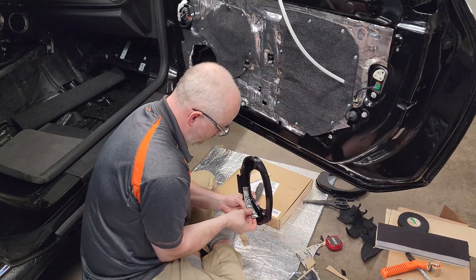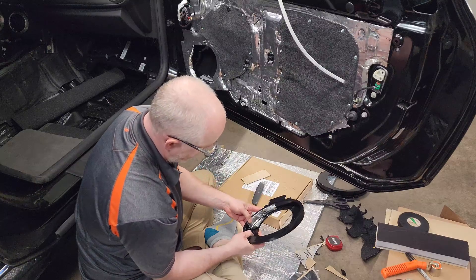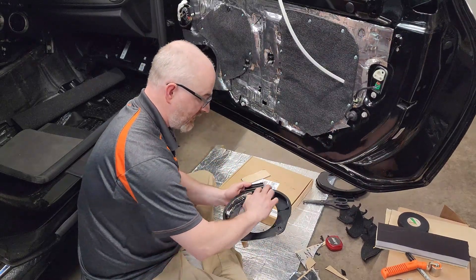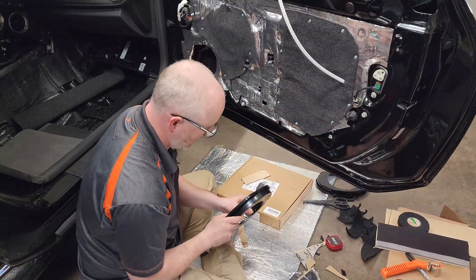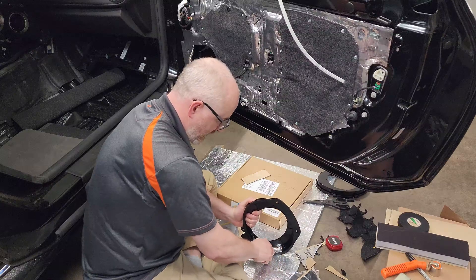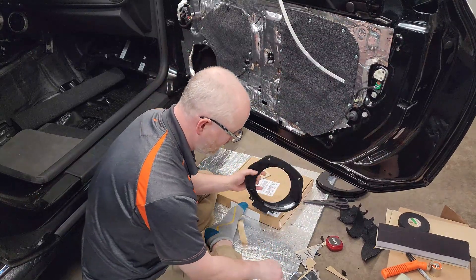You're going to go through and apply cleanly — I mean, you're not going to do this in a messy way because you need this to fit. You can't go past this surface. We're going to use CLD butyl rope to go around here, so when we press it on it's essentially a damp gasket. For fitting pieces in, use whatever tools you've got — you can always retract your blade and use the box knife handle with the blade retracted. We'll treat this entire piece one section at a time.